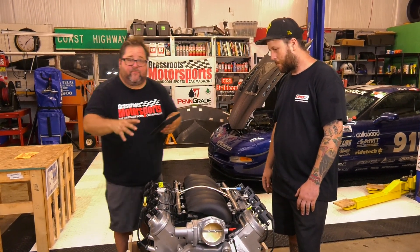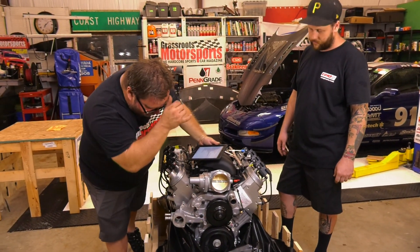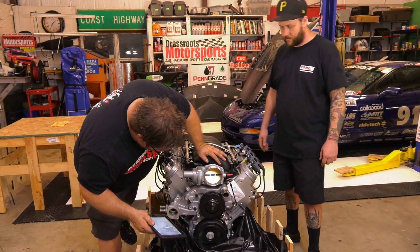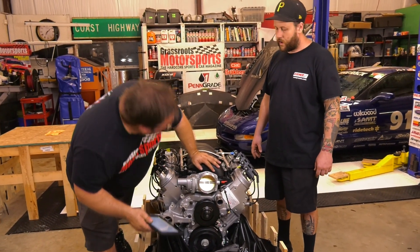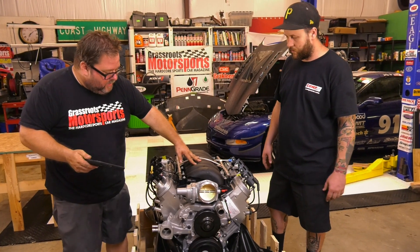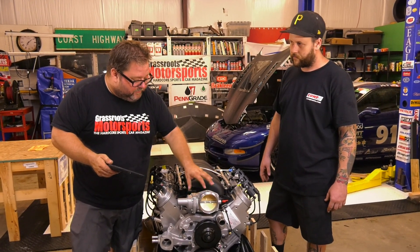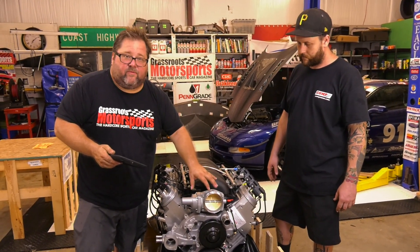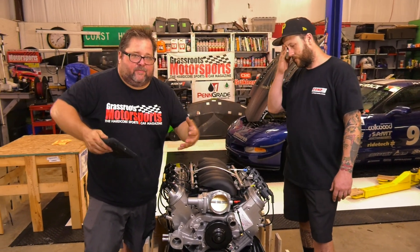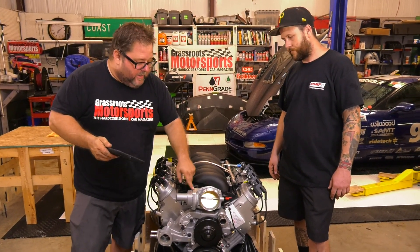This one will be getting a few things. Obviously we have to install our dry sump system, which means replacing the crank pulley with the proper pulley to run the belt-driven dry sump. We're not sure yet whether we need to replace the water pump until we compare it with the old one and get the belt drive all together. One thing we're definitely going to have to do is deal with the throttle body — this LS3 throttle body uses a very different throttle map than our LS6 throttle body. Since we can't adapt to it, we need to put a little computer box in between the two to flip the signal and get things moving the right way.